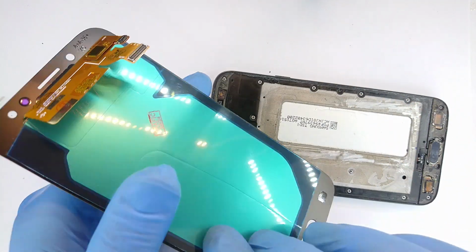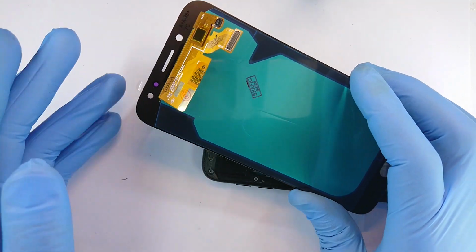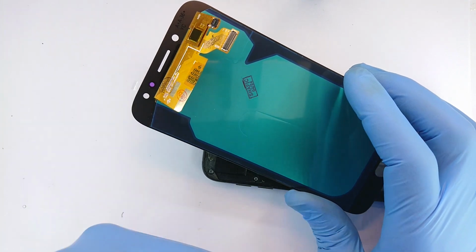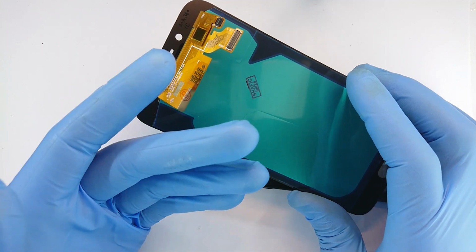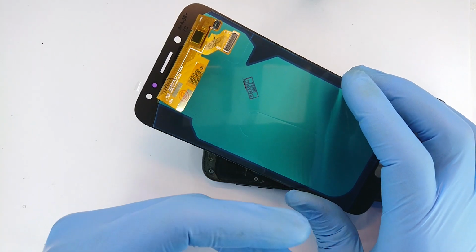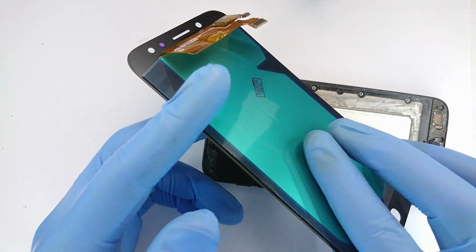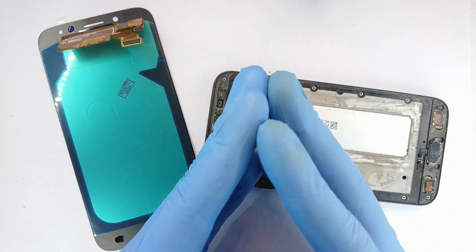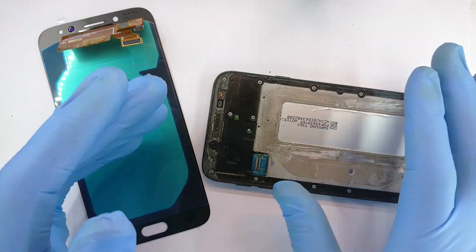So refrain from it. Strangely, on the market, at least the Ugandan market, those are the same price, the OLED version. So it's up to you to be able to visually tell apart a high resolution screen from a low resolution screen, and that means you should have at least seen how the resolution of the original screen looked or looks like. That said, the LCD type is slightly above half the price of the OLED replacement screen.